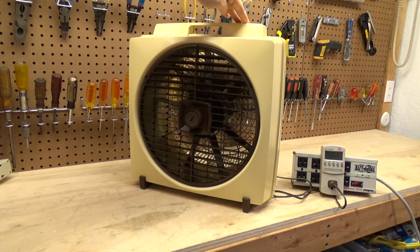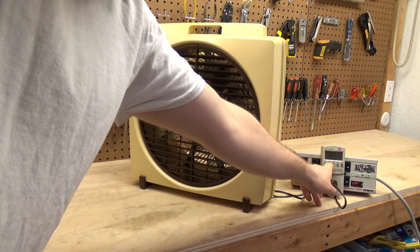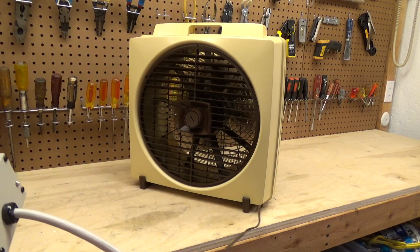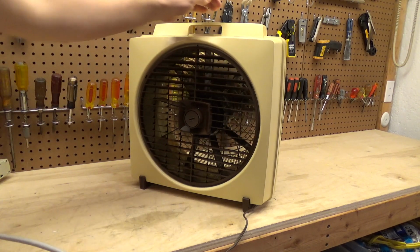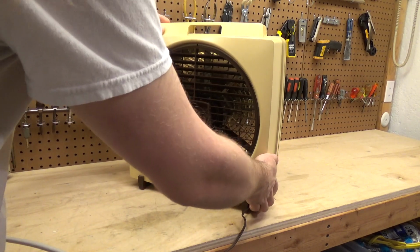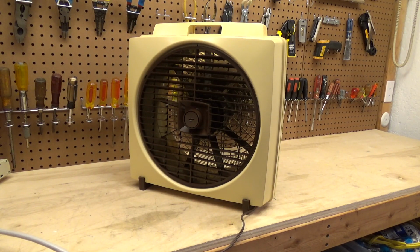So that's about halfway up. It's not half speed though, it does go much, much faster than this. Halfway up the dial, it's pulling 1.71 amps, 80 watts with a power factor of 0.39. Move this over here instead of standing in front of the camera. Alright, let's go up a little bit more. Let's say 75% power. It's in pretty good balance too. It's almost in perfect balance. So now we're about 70% up. 1.95 amps, 108 watts with a power factor of 0.46.